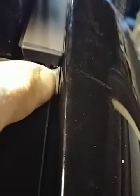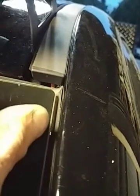So I cut back the casing on this. You can see it. That way I could get the 2 wires down next to the little seal that's on the drip rail there, and then I was able to run them down here. I used a feeler gauge. I know most people don't have those handy, but I used a little feeler gauge and lifted this little seal up all the way down. As I started the wires up here, I used the feeler gauge to hold that seal towards the window and slowly work those wires underneath that seal all the way down.